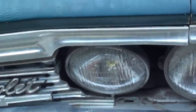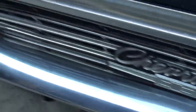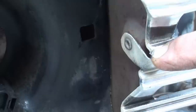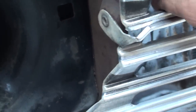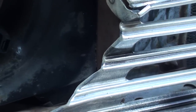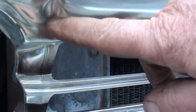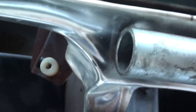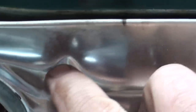So I'd have to have the headlight in to determine this contour here. I certainly can't use it from the headlight bezel, but I have this. So I know I've got to pull it out far enough to where that comes back. No time like the present, I guess. Before I pull it out, I want to try to get that contour back. So I have to match this contour so I can come down and use that to try to push that back in.